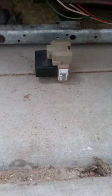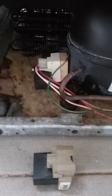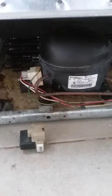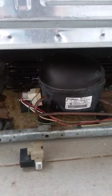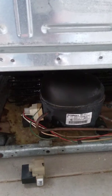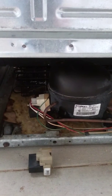This is the old relay overload in a capacitor start unit. I just happened to have one floating around from another fridge, and it fit in perfectly and the refrigerator works perfectly. This was the classic example where you get the buzz-click, buzz sound — you turn the refrigerator on, it clicks, it tries to start and it clicks.